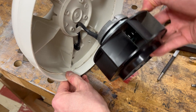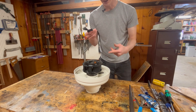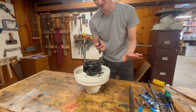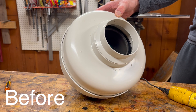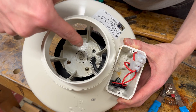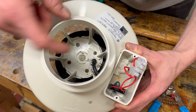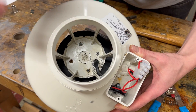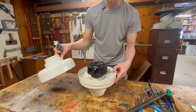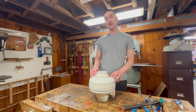Now we can push the motor back in and put everything back together. I've cut the end off a plug and wired this up so we can test it before siliconing everything back together to make sure everything sounds good. Down inside we want to get some silicone in here and also where we loosened up the wire to access the motor. Then I'll run a bead of silicone around the outside and glue the bottom back on. I'm going to wait about a day for the silicone to dry and then reinstall it back in the house.